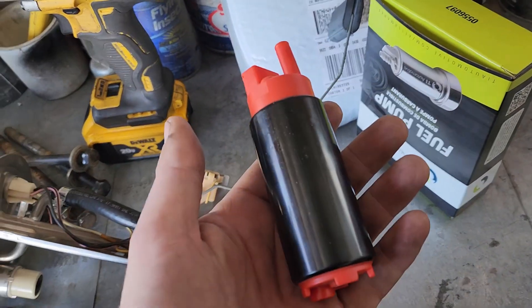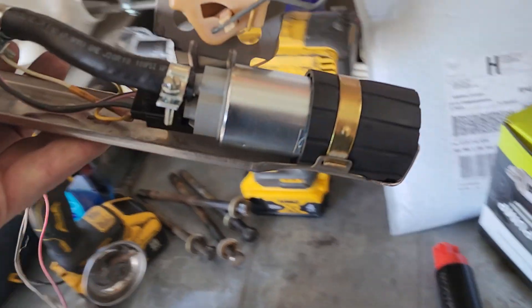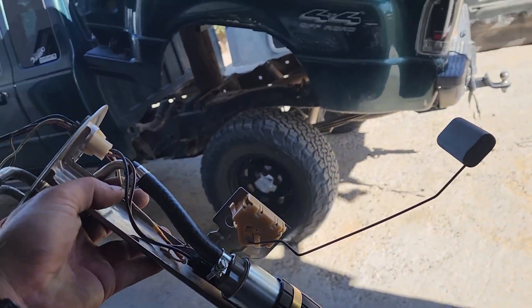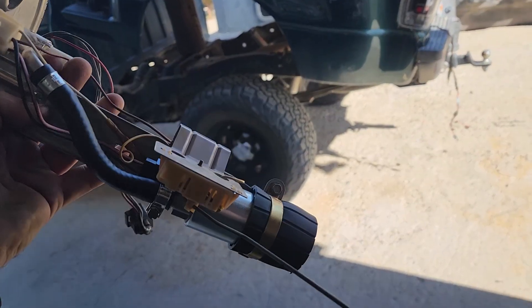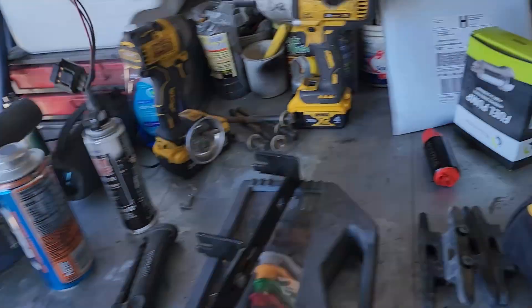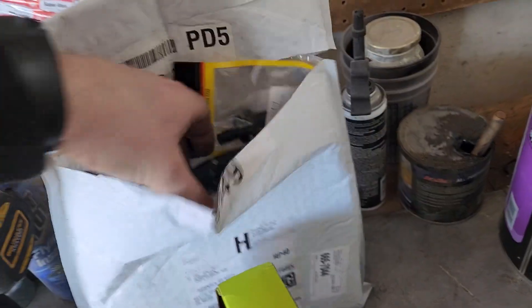I'm back at the truck and I got a couple things I need to upgrade. I bought what I thought was a Walbro — was not — so I bought an actual Walbro 255 fuel pump. I'm going to be putting it in the truck. I got the truck dump-trucked right now so I can get to the fuel pump. I removed the in-tank pressure regulator and I got a few other fuel upgrades that I'm going to be doing.